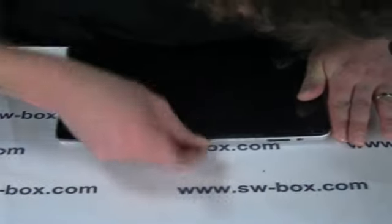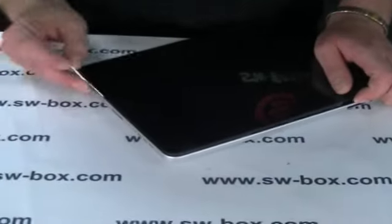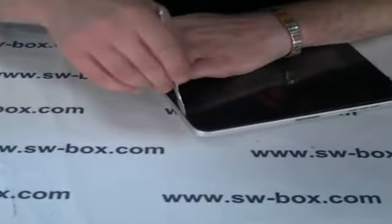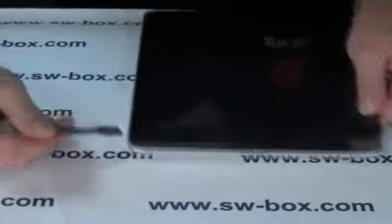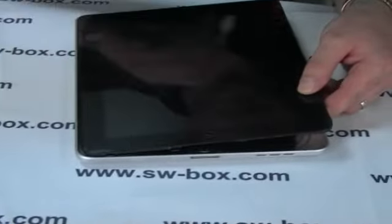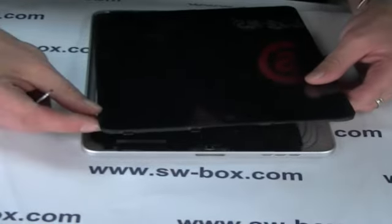Just a word to those watching this video — normally I'd have this on a tripod, but since this is a how-to-replace video, I need to be up close and personal with Neil as he's doing things. I apologize for the camera shake, but it's necessary so you can get a feel for what he's doing. Neil, if 100% was full force, how much force are you using? When I first did it, because I've broken the seal, it's very easy. But these little tags do snap very easily, and when I first did it, it took me about 20 minutes to break the seal — you just have to persevere. The chance of breaking your screen is very unlikely because all you're doing is this rubber seal, which tucks under the lip on the bottom plate.